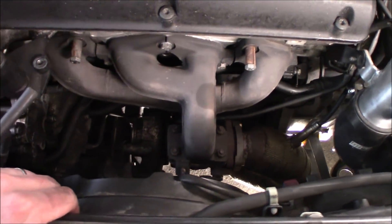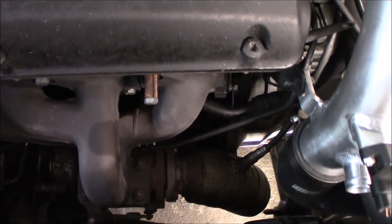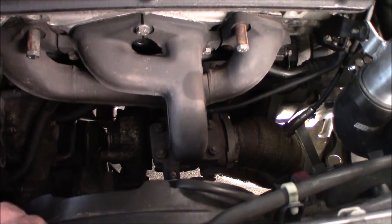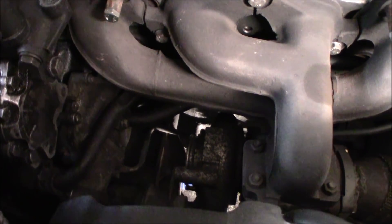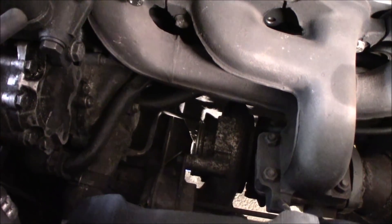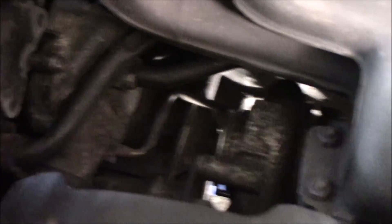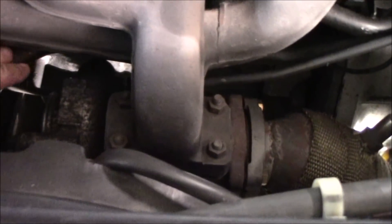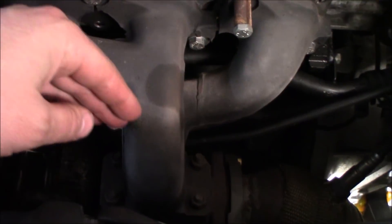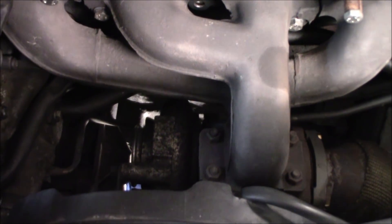This is the current look with the original 15T turbo together with the three-and-a-half inch down pipe. You can see it sits pretty tight. Right here is one of the spots that's really bad for the 9-5: the compressor of the turbo sits so close to the water pump that it's almost impossible to get a really nice inlet for the turbo. On the new setup, the turbo will sit a little bit higher and move to the side, so I think we'll have a much nicer flow into the turbine.